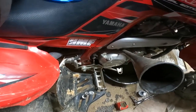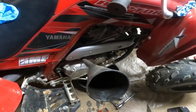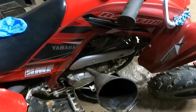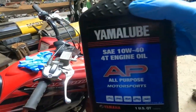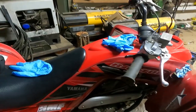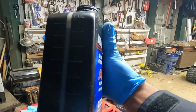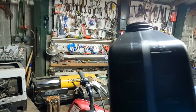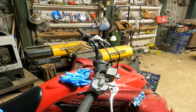So I finally found a funnel and my camera died, so I had to grab another battery — this is taking a lot longer than I expected. Please like and subscribe, it means a lot. I'm going to be using Yamaha Lube 10W40. You want to use a little bit over half — I'm probably going to go somewhere between 16 and 20, something like that. We'll just kind of go from there.